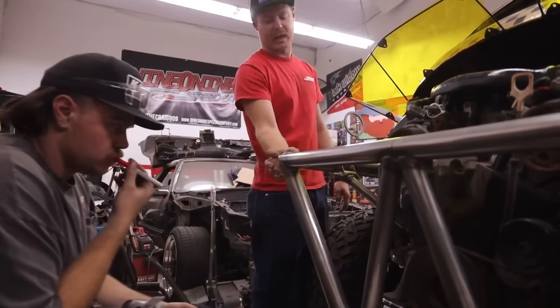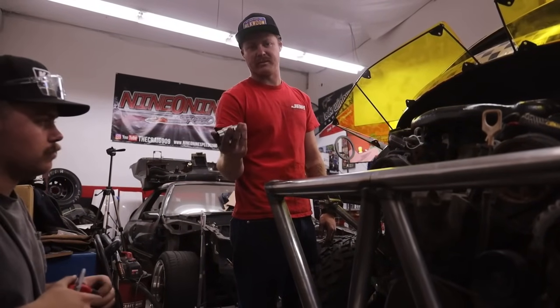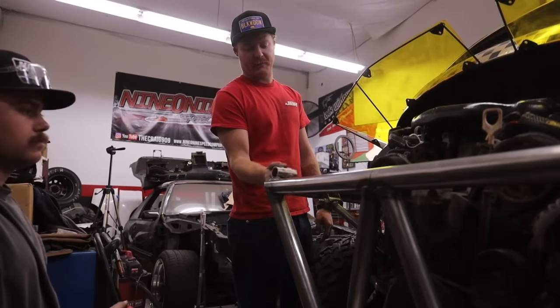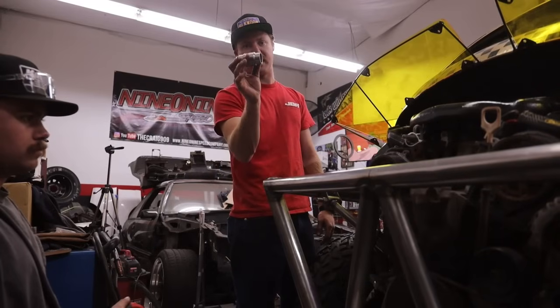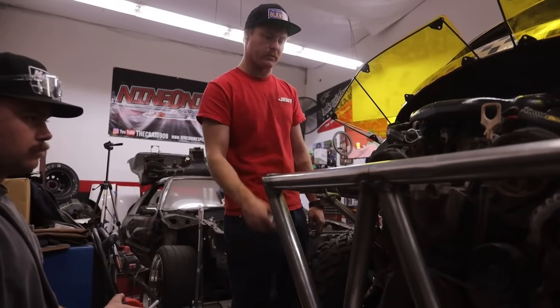What this allows us to do is add, I mean, technically I think it was like 2 3/4 or 2 5/8 or almost 3 inches realistically with this thing if you wanted to. But we're gonna basically cut this in half, add this connector in, see how the tube sits, and then we'll probably take another inch out of the cage because this is gonna add like 1 5/8 to our overall dimension. And it'll kick the cage out just a little bit from where we initially built it.